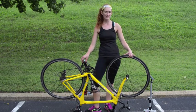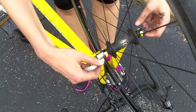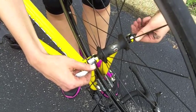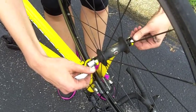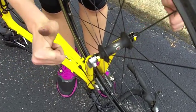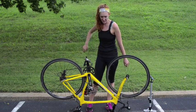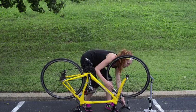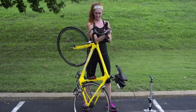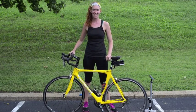Line up the lever in place with the fork and hold the lever about halfway closed. Once it is back up, turn the nut to just finger tight and press the lever back down. This needs to stay good and tight because you don't want your wheel falling off. Double check that everything is tight and good to go. After you're done with that, pick your bike back up and now you're ready to go.